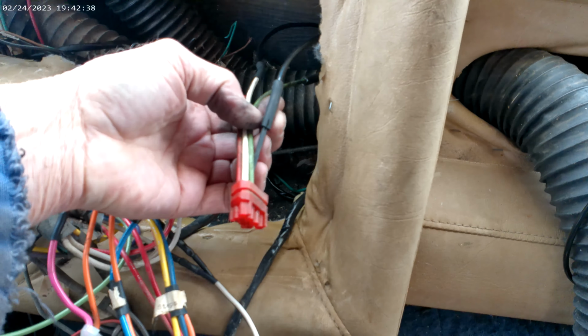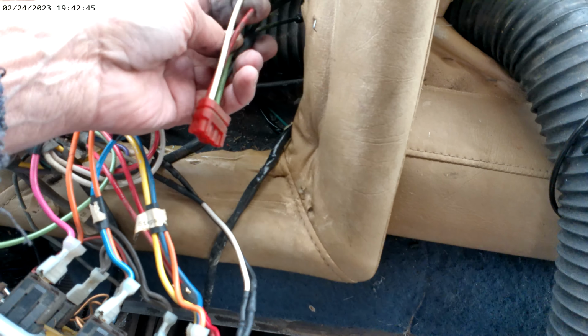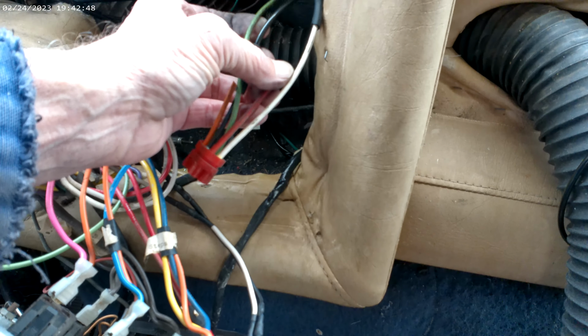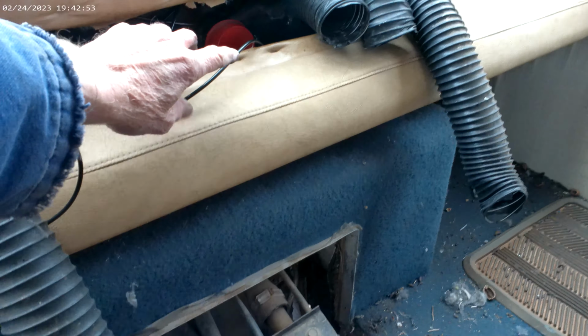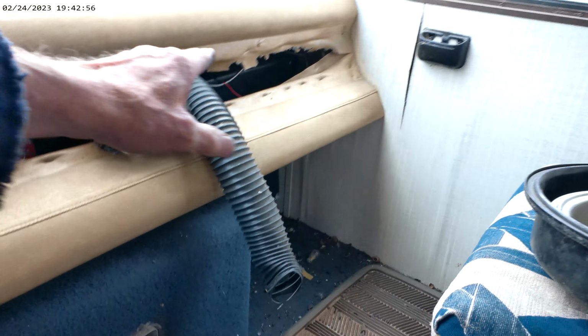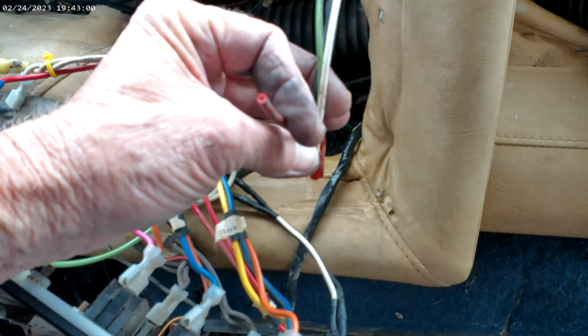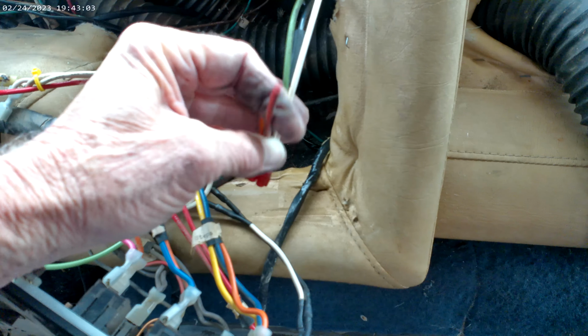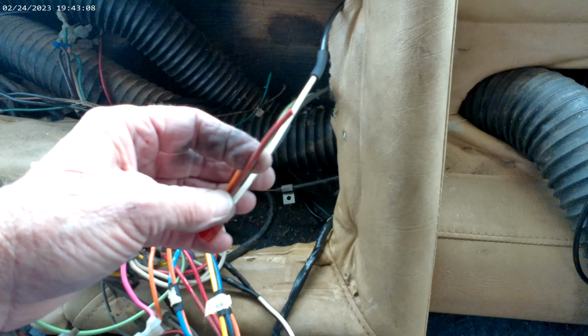So what we have so far, it's got your primary vacuum feed into the control circuit or into the control panel. The white one goes out to the blower box. The green one runs right here. The red one's over there. Looks like somebody cut the red one off and shunted it because it may have already had a leak, and it's a vacuum leak. So I'll have to check that one to make sure it's fixed. So I'm going to run the red one.